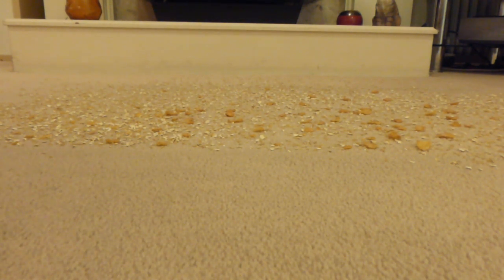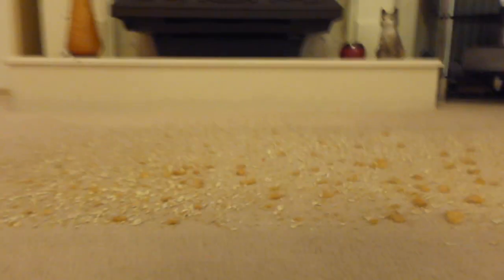So no, there is no, or doesn't appear to be, very much bouncing of the rice particles or the couscous on the carpet in front of the floor head, which the DC40 Mk2 was pretty good at. But nevertheless, this cleaner has actually got all that up no problem at all, including the cornflakes. So now we will do it on this next section, right, with the suction valve on the front on the plus position. That effectively closes off the large debris channel. Okay.